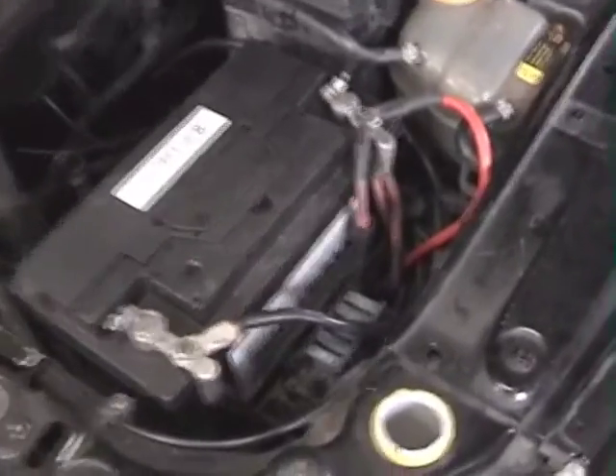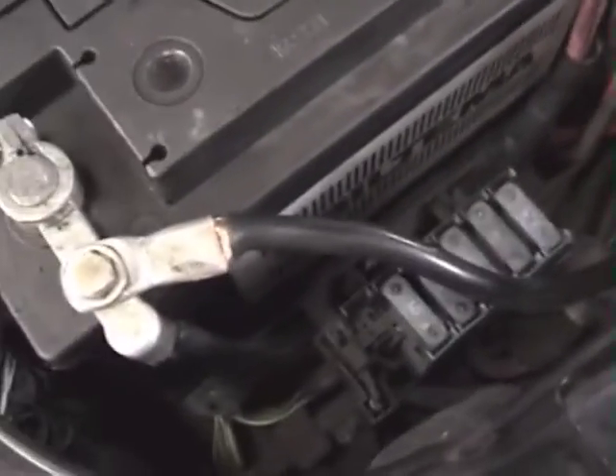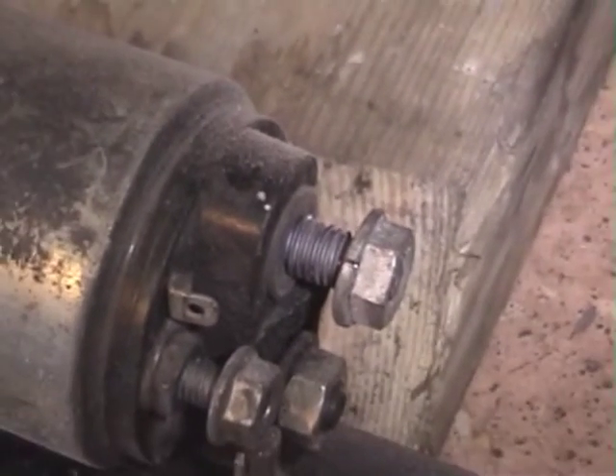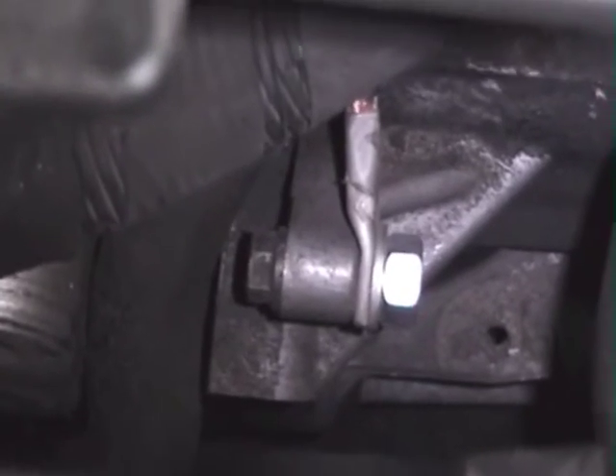So this is the solution: you add an extra thick cable to the car — positive, negative, and on the starter. This is an old starter; there is no problem adding an extra cable. You can have both the original cable and the extra cable connected — just put it underneath here along the original cable. Then I put the negative down here at a connection that was not used.